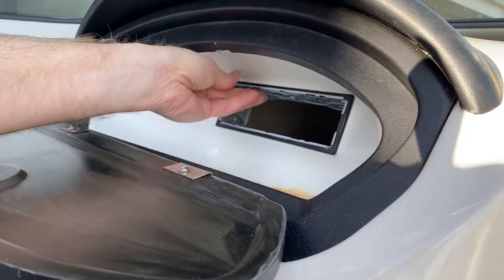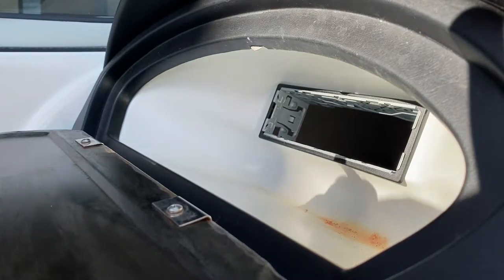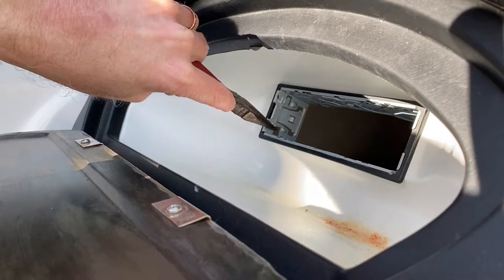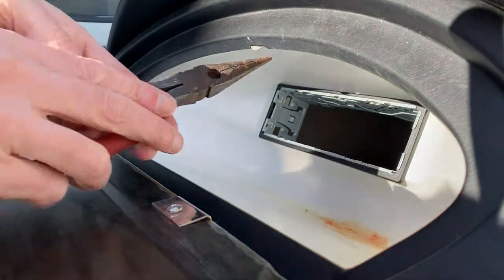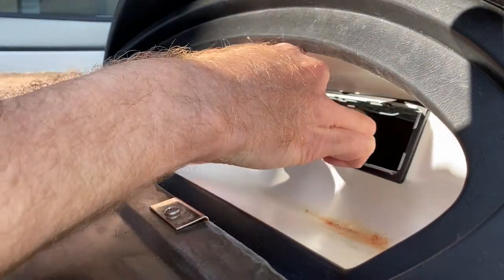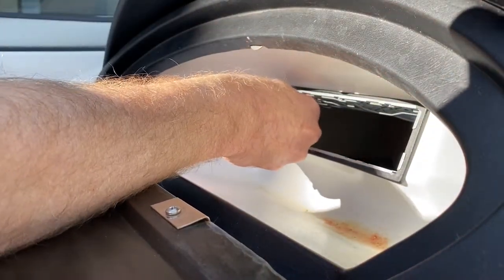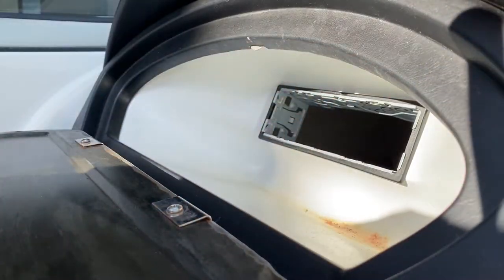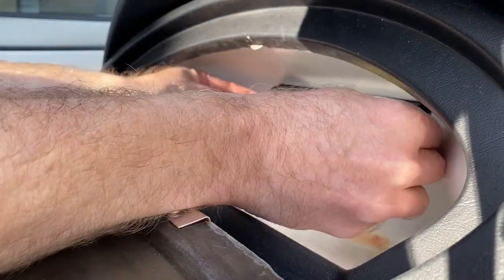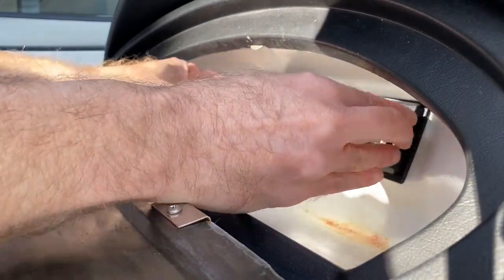I've got my trim ring and the new cage, which slides in like so and fits into the gap available - that's a lot more secure, exactly what I wanted. Then I push the locking tabs up top and bottom to lock it in place. Using a pair of pliers - you could use a screwdriver - I bend those tabs in, and you can see it's locked nicely in place, not going anywhere. With the cage in place, the head unit locks in nice and secure.